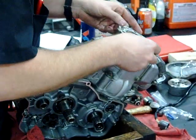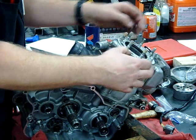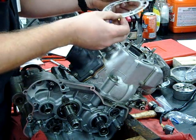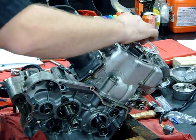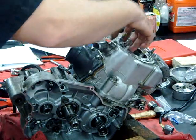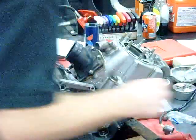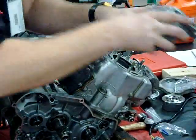If you were to do this the wrong way, the gasket will fit in numerous different patterns, but it's going to block passages for the coolant. I had a student one time who put one wrong on a CR500 — two of the bolts were a different size, so it severed the gasket and as soon as we got the bike running it was pumping exhaust outside the head. Also note: we have two precision dowel pins — they want this thing to be exactly where it was designed to sit.